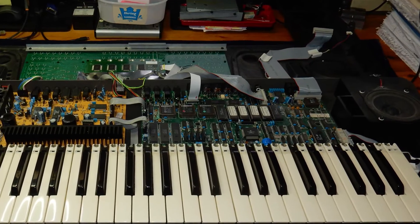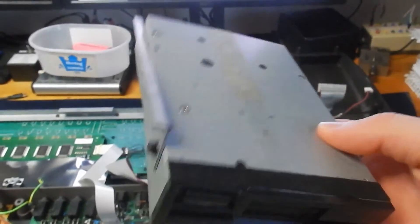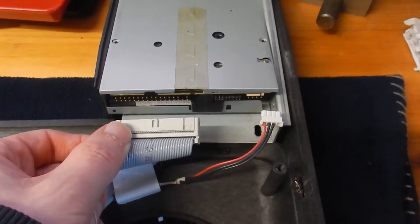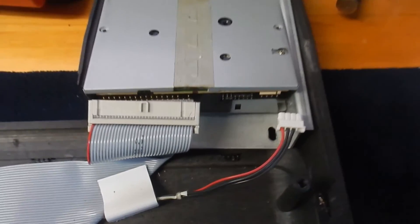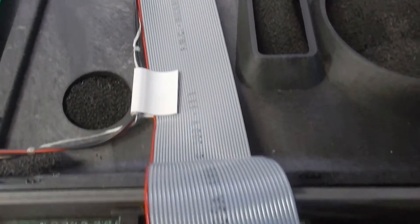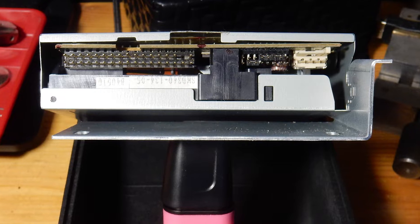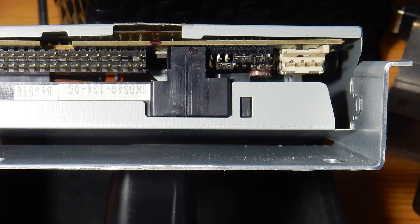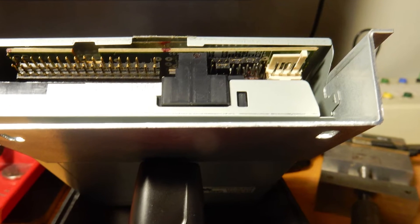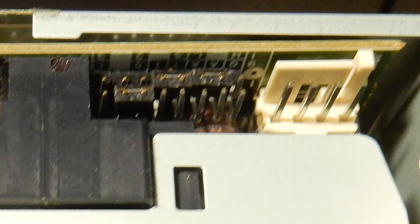On the right side of the keyboard we find the right speaker and the floppy drive compartment. The drive is an Epson model SMD300, a 3.5-inch high-density drive. This is a universal drive with configurable jumpers — you can install it in a PC if you change the device jumper. The WX2 is set to DS0; for a PC it would have to be DS1. Unlike a PC, the WX2 uses the original plain vanilla floppy interface with a straight-through ribbon cable, as opposed to most PCs which have a twist in the cable. So if you ever have to replace the drive with one sourced from an old PC, you may need to mod the drive, as most late-era PC drives are hardwired for the DS1 setting.